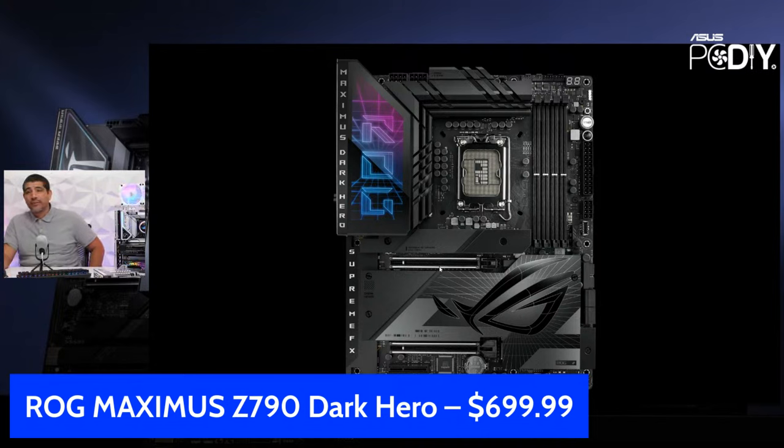And keep in mind that from putting it in a water block, even if you ran a 4090 at x8, it is effectively the same exact performance as x16. So there's no performance penalty to running it in x8 versus in x16. But keep in mind that it's going to be one of the differentiation points.